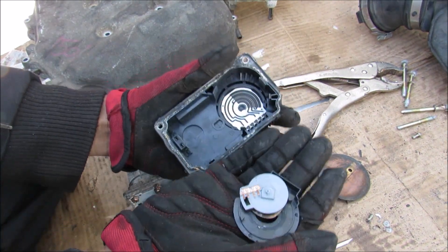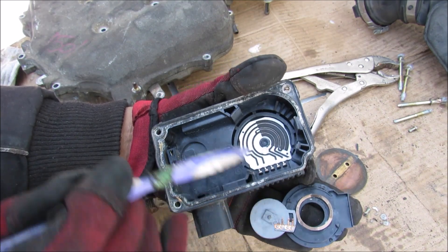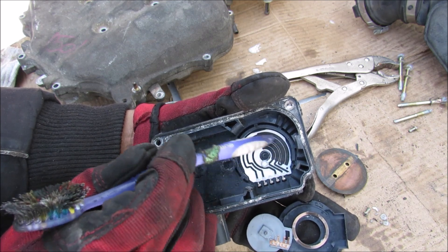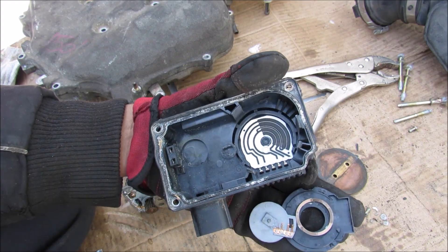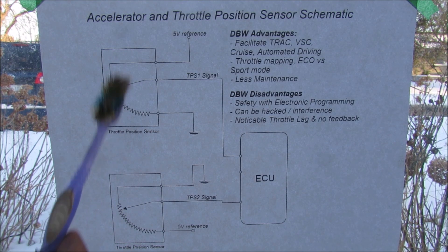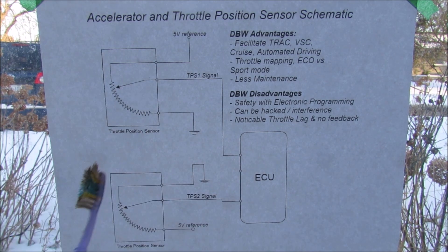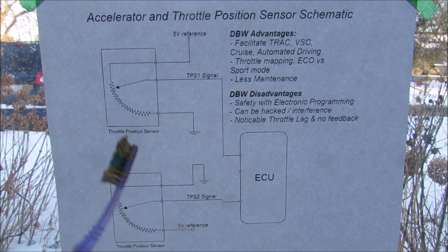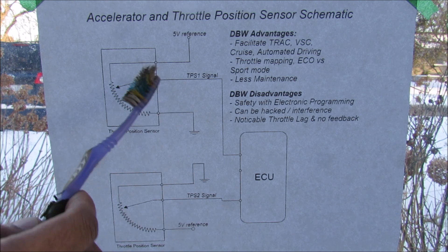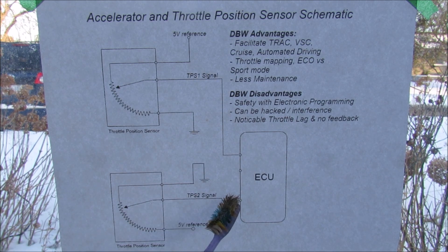We can have a look at the potentiometer inside. The throttle position sensor has two wipers that wipe two separate tracks on this potentiometer — that's there for redundancy to send two separate signals out to the ECU. Looking at the schematic, the accelerator and throttle position sensors each have two individual potentiometers connected to the same physical arm, so they both move the same amount. One side is grounded while the other side is at a 5-volt reference, making them inverses of each other, and both have a signal line that feeds out to the ECU.